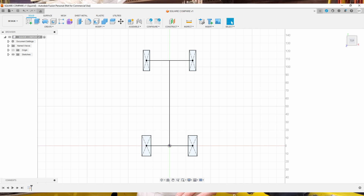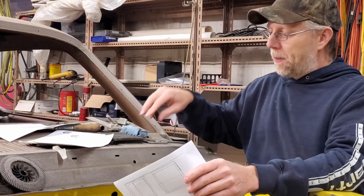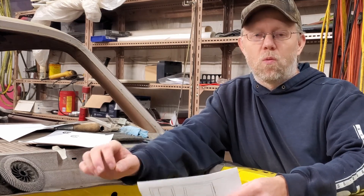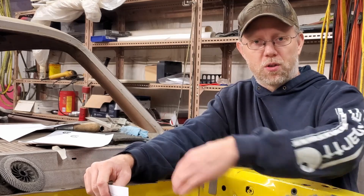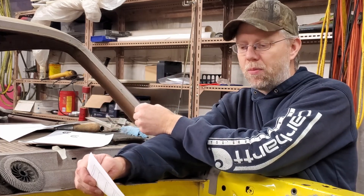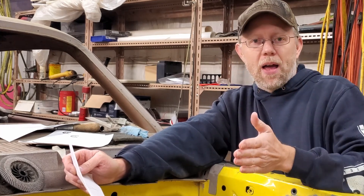So what would happen if you picked one point on the car to measure everything in the front suspension? I did a little mock-up on the computer to make sure I didn't add any trigonometry errors doing it by hand. I found that if you picked one point on the back of the car to set your front cross member to and thought you could get it square — say you ran a string from front to rear and picked a point aligned with the rear spring mounts — and you measured to each side of the cross member to square it up, thinking it'll be close enough...